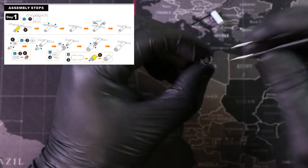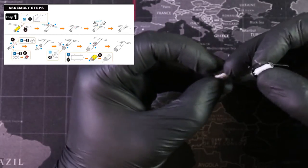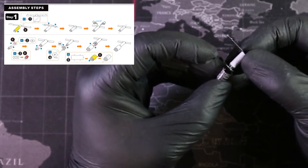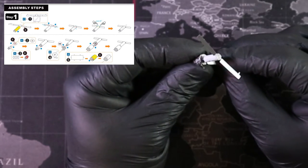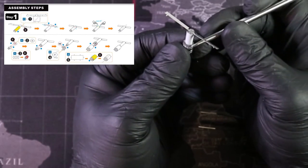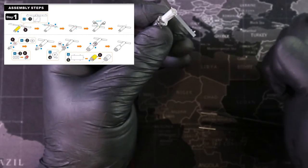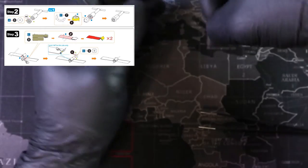That's pretty good — there's a little bit of a teardrop right here, but the way I'm hiding the tabs you might almost have to accept a slight teardrop. I'm making sure all my seams are in the same place. When bending tabs, get as much of the tab in your tweezers as possible so pieces are really connected well. If even one is misshapen, you're almost done for. Let's move on to step two with part six.